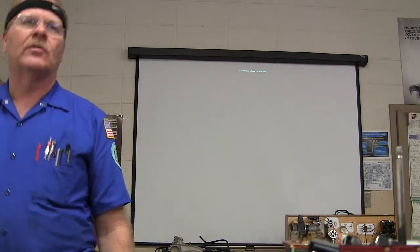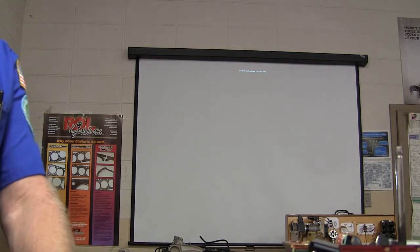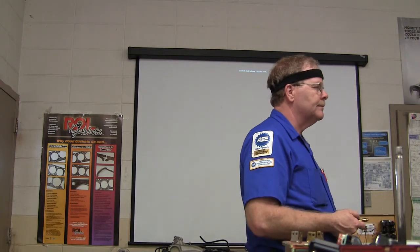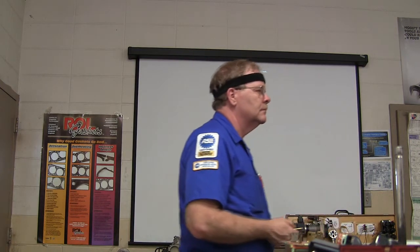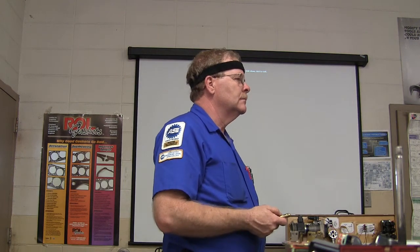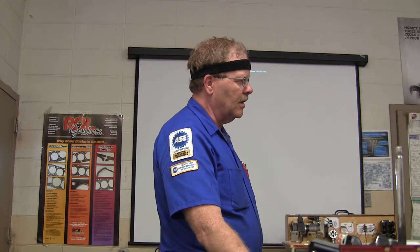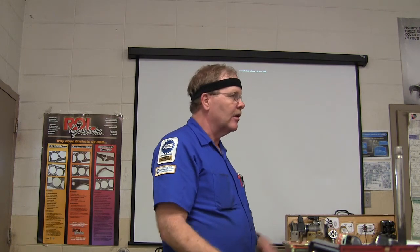That's the end of the slideshow. A student asks: with electronic steering, if you're running down the highway at 60 mph and everything just stops, what happens? The way this system is set up, you can still steer the car, it's just hard — like driving a car with a broken power steering belt. Even though it's all electric, the way they've got it set up you can still steer the car. It's not totally drive-by-wire. That's something you'll need to look up and report back on tomorrow.